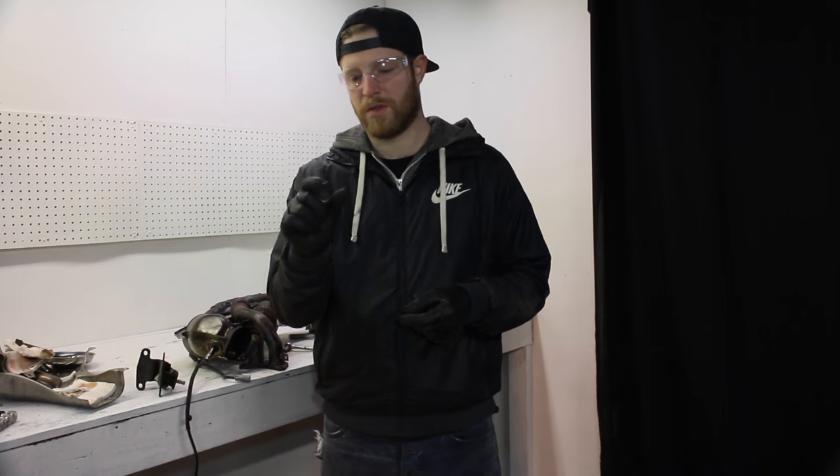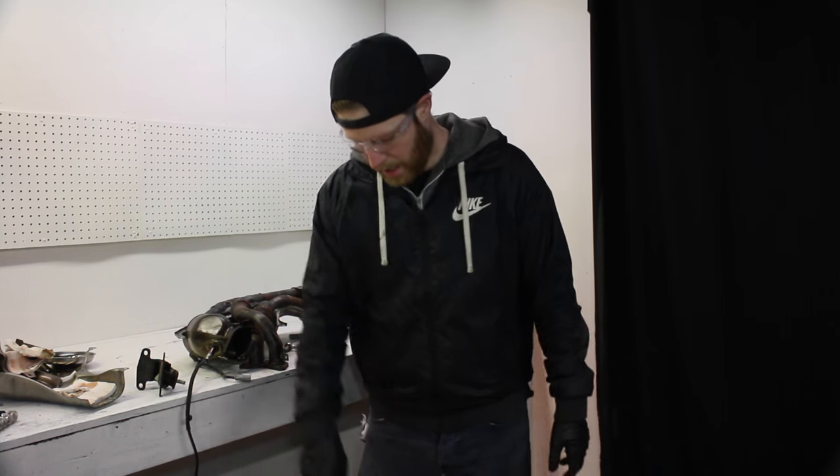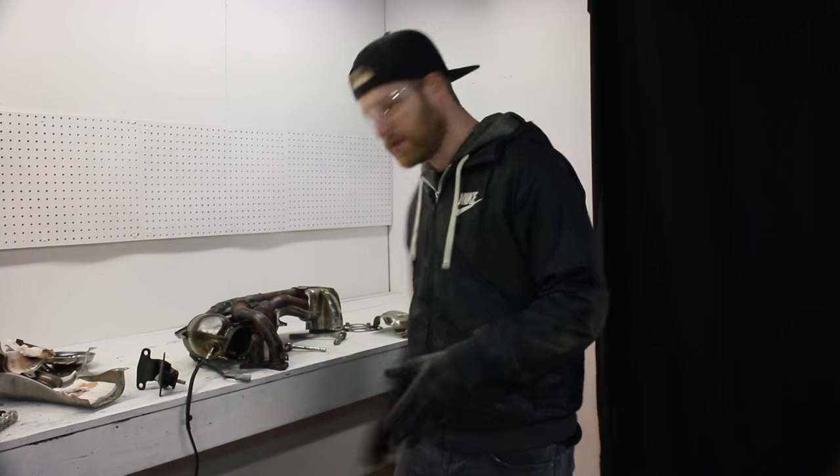Here's what else I found when I was under there - there is another oil leak, a very small half-inch crack on a piece that is only half an inch. Our JB Weld is holding up really great on the other piece we fixed - it's not leaking at all, no signs of any oil around that. I'm going to do something I learned from a commenter: grab a crayon and draw along the crack, which will cram wax into the crack so the oil stops seeping out and you get a clean surface. So I'm going to run to the store, buy some crayons, top up on JB Weld, fix that crack, then continue reinstalling the exhaust manifold and the Nameless Performance overpipe and front pipe. That should get us back to around the transmission mount, and that's where we'll have to stop until I get a new transmission mount.